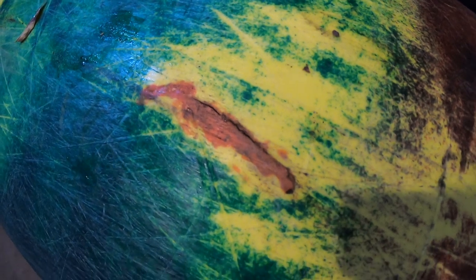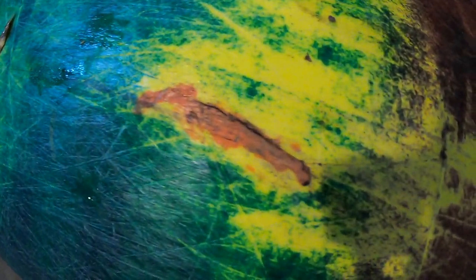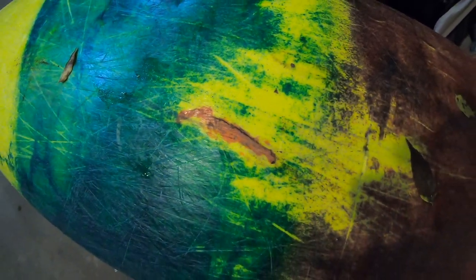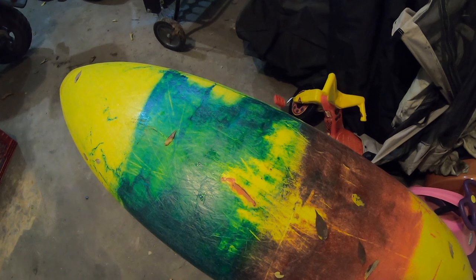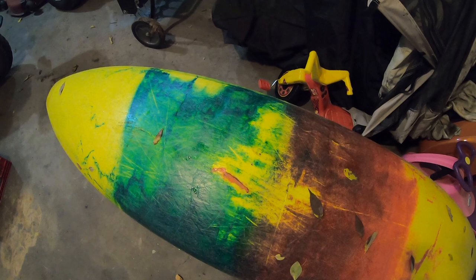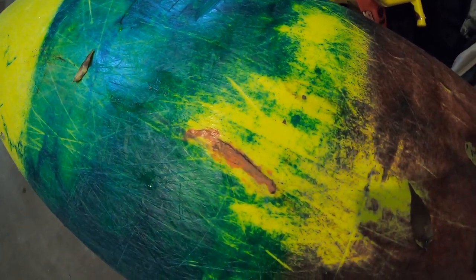What we're going to do now is disassemble the hull and drill the crack out. You want to take all the parts out of the hull — like the seat pan and everything — because the last thing you want to do is drill an unneeded hole in your seat or damage the seat pan or seat rail. One of the flaws of some kayak seat pans is if the padding moves or wears thin, the plastic-on-plastic tends to rub through and progressively wear out the hull on the inside. Anyway, we'll take out the interior and start working on this.